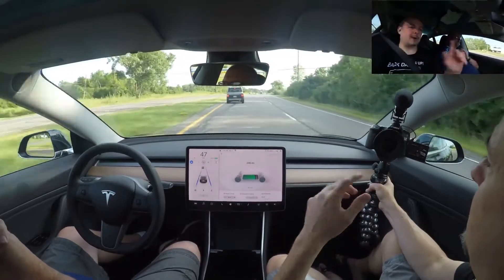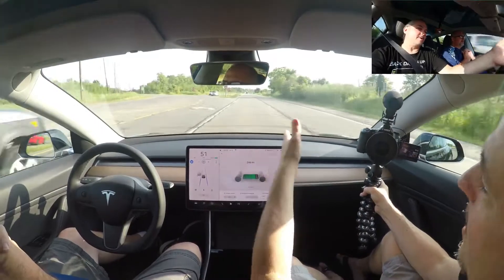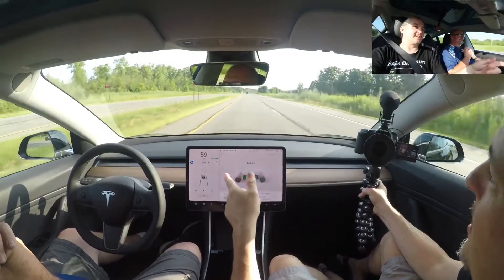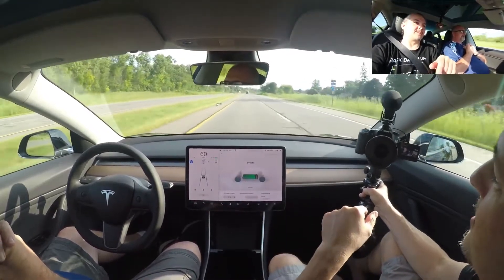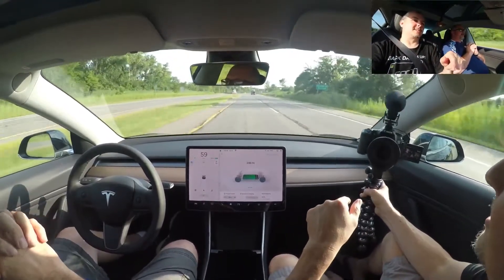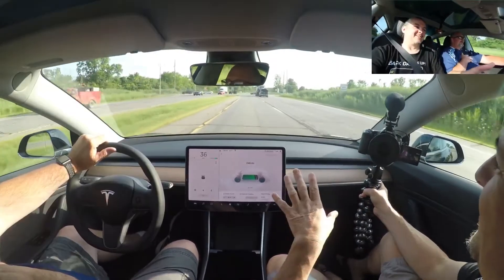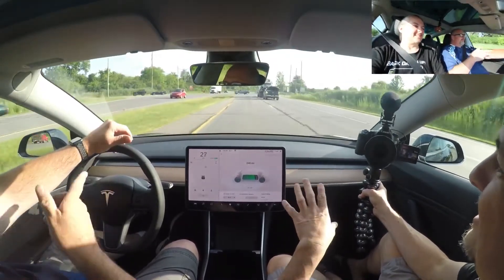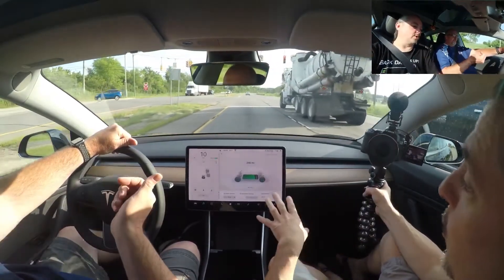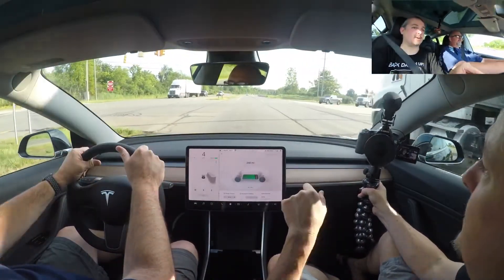I'm going to dive deeper in maybe another video. When people hang out on the other side of the line, even if it's one tire over, it'll react. The car accelerated to the set speed, but it's going to see these cars up ahead and slow again. Tap the brakes — it doesn't know red lights. We would have blown right through that red light. So you don't want to use autopilot at red lights. If you get the full self-driving update — this is not the full self-driving — that update will have the ability to see red lights.